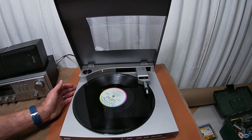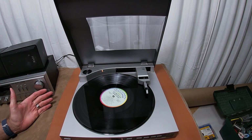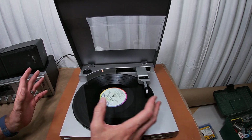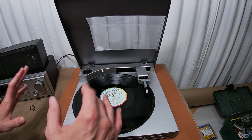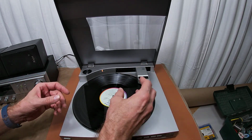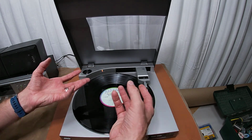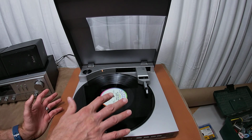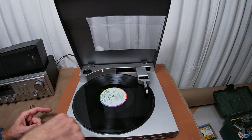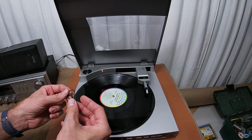When I get one of these, I usually replace the belts and lube it, which is really super easy on these. Basically take everything off that can damage the cover, seal it down, and I put some bubble, what are those things? Amazon usually throws them in the box. They're just like sacks with air in them. Put a couple of these in there just to make sure things don't jolly around. Close it, turn it over, take out the 9 screws, and put in a new belt, these are the old belts right here off of the last two.